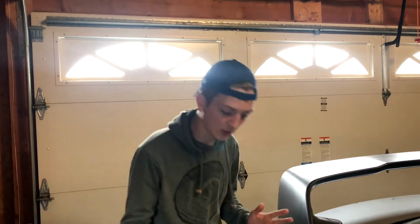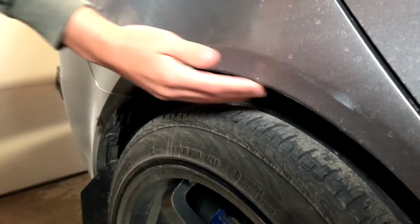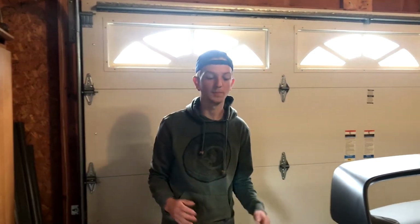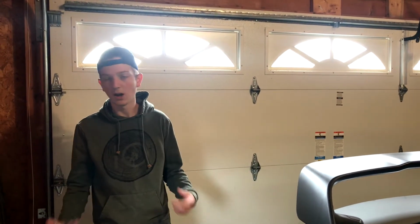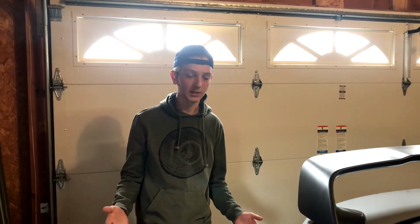Like I said, for you guys, maybe paint or prime and then paint and clear underneath, so then you don't have chipping go all the way up your fender, which would not be good because then rust and stuff. Like I said, it really helped out with the offset, and you could definitely do this with any offset you have. It will help out regardless of how much you have. You'll still rub, but it will help out with saving tires.